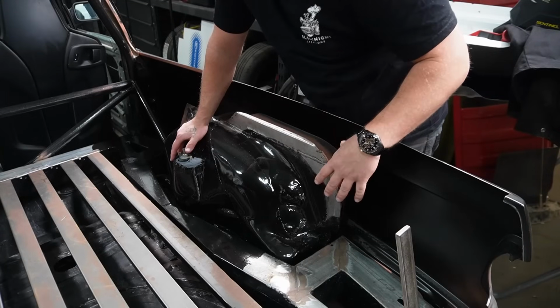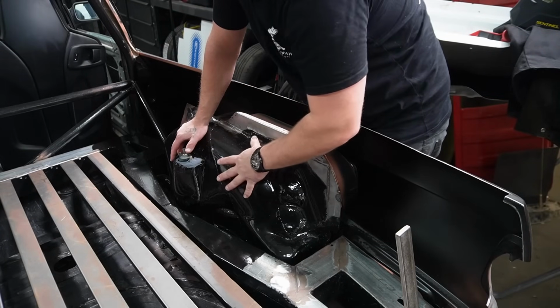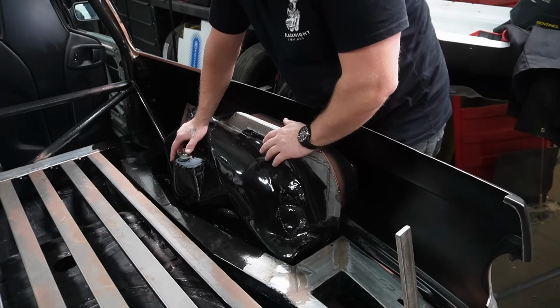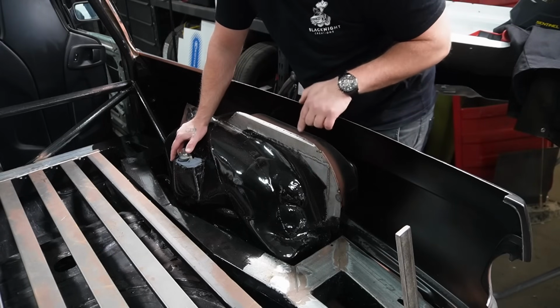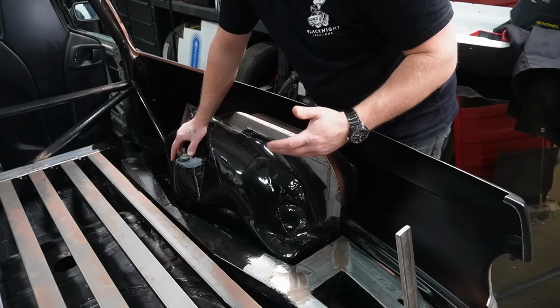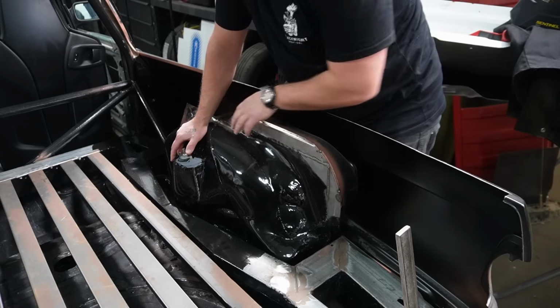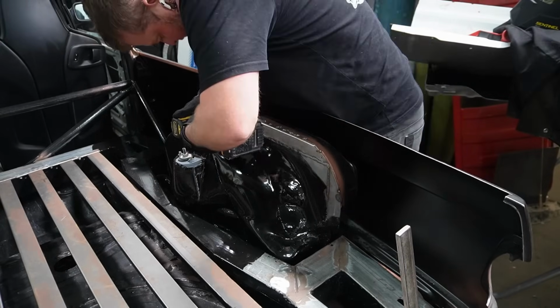The next step is welding in both of the M3 wheel arches to the chassis, because when we put the big ute wheel arches in, we're not going to be able to get to this again. I've punched some holes in it already. They're not big enough. You want to use, say, at least a 6, if not maybe an 8, to then get a really good, nice size plug weld. So I'm going to have to drill these out, weld this on.